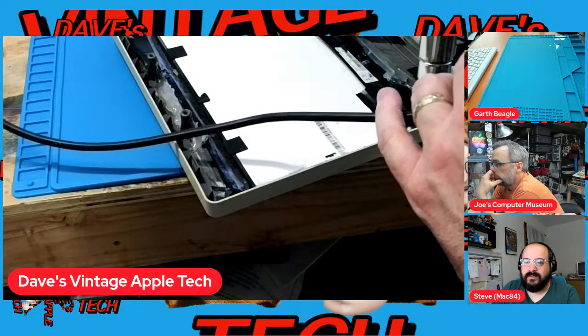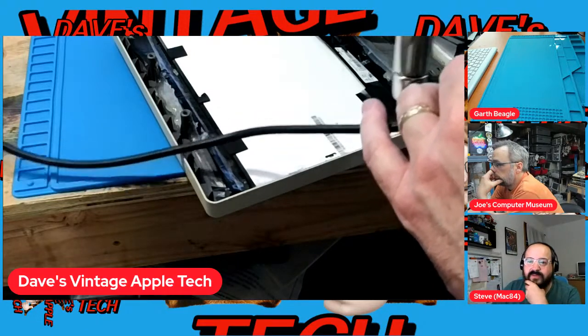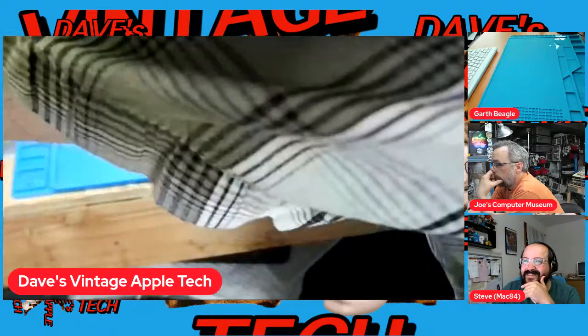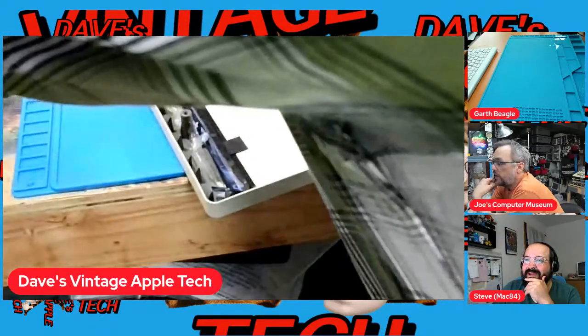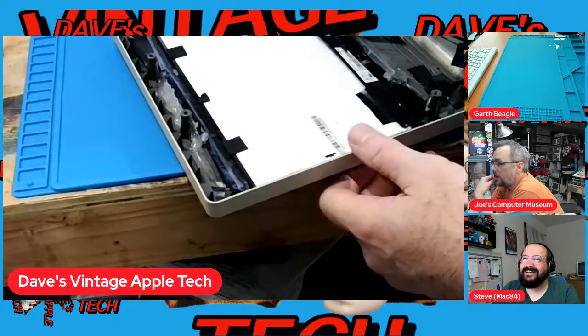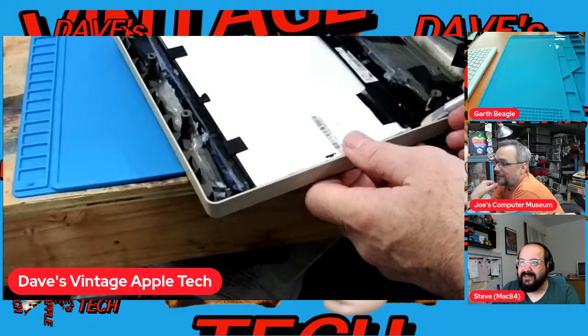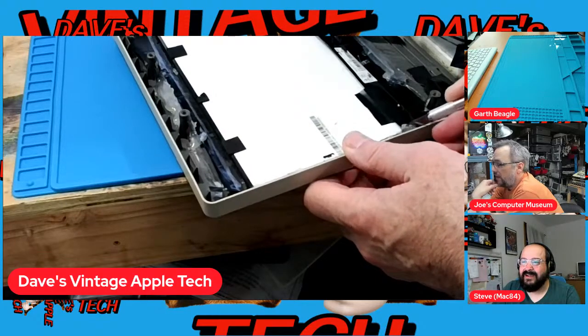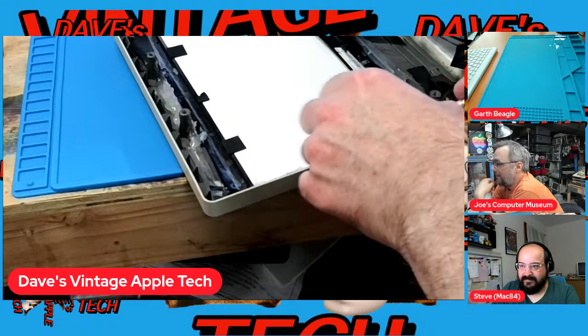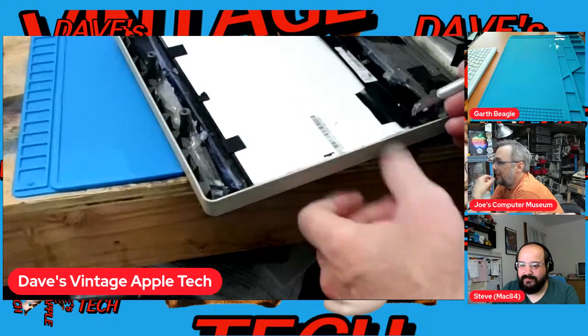Okay. So there's like 3 download links. How do I... how do you... I sent you the newest link. Go to that GitHub. This is the Blue SCSI update. Then click on the green code button and say download zip. Correct. Okay. And you unzip.